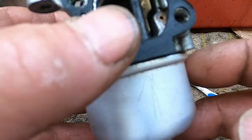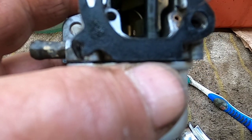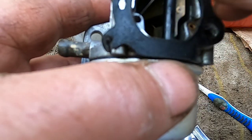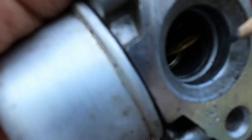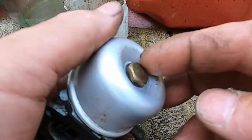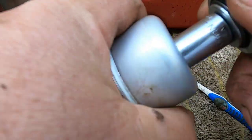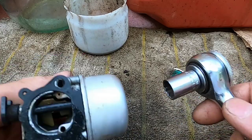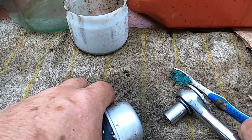I have this cleaned off reasonably well. Before I open it up I want to point out these are the spots where it'll be clogged: you have this opening here, this over here, down in here, on this side. There are some idle ports right in here — usually three little holes right in here and they get clogged. To get this bowl off you'll need a half-inch offset wrench or socket. You can see how it's recessed so the regular wrench is a little tough getting in there. This came off real easy — no problem.